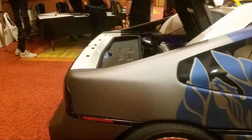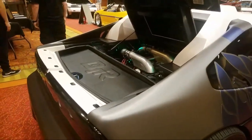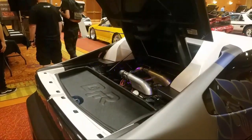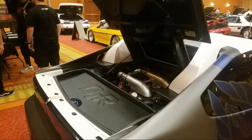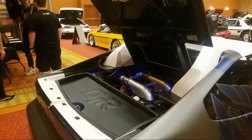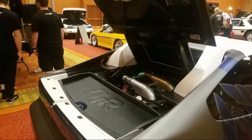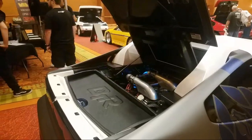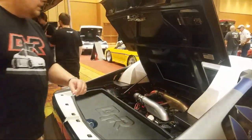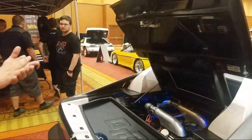So the way we used to make these in production assembly, we used the stock Fiero throttle bodies. We took one of them and ground out the IAC and filled it in. We took the other one and ground out the TPS and filled it in. So one had TPS, one had IAC. Works great, but then we also had to manufacture the, what do you call that thing, the thing that connects your throttle blades.